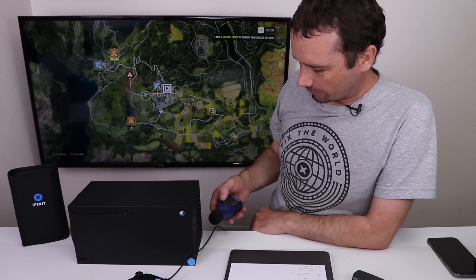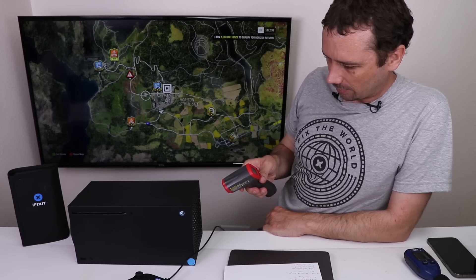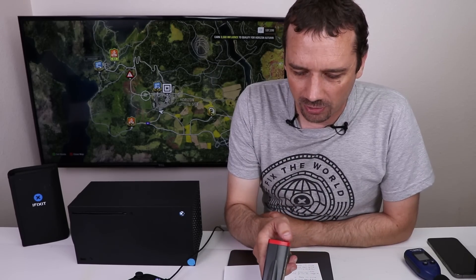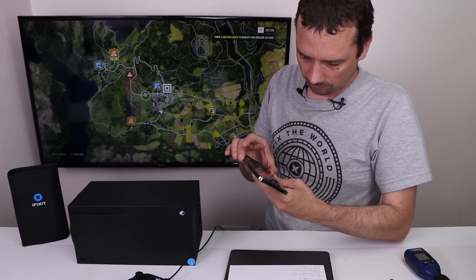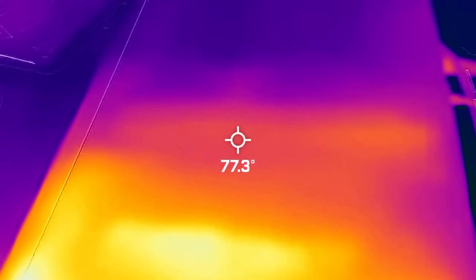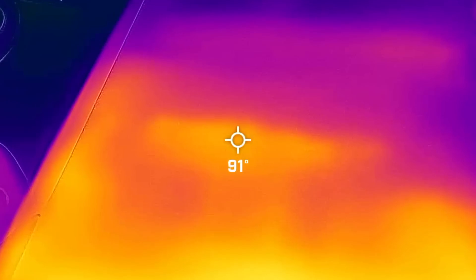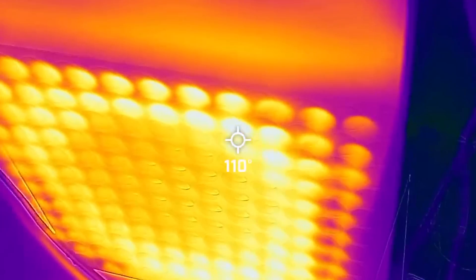It's been about 30 minutes, so let's check all the temperatures again. We got a sound reading of 27.8 — exactly the same as the previous measurement. Temperature at the top of the exhaust vent: max temperature was 129 Fahrenheit or 54 degrees Celsius. The hottest part of the case was 113 Fahrenheit and 45 degrees Celsius. Interestingly, the hot spots on the case are actually cooler than they were when it was just in the dashboard, so that fan is really pulling the heat out of this thing.